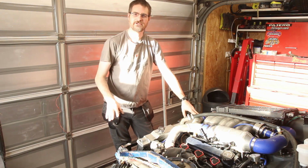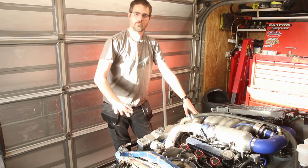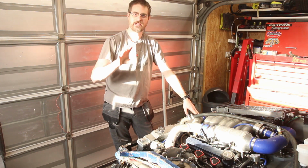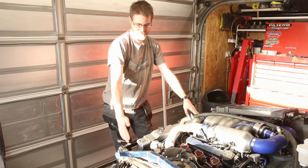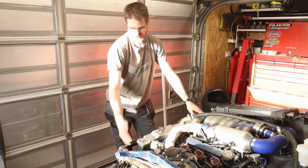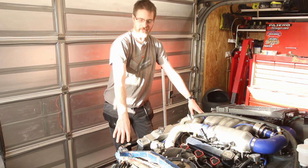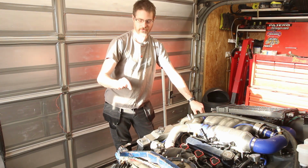There's also another complication. I want to add in a bit of a header tank just so there's a store of water and to allow a little bit of expansion when the water starts to warm up a fraction. And what I'm thinking is that down sort of in this triangular section that's made between the edge of the radiator and the inner arches, I want to put a triangular shaped reservoir over there.